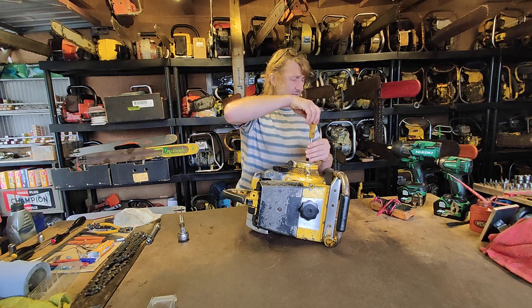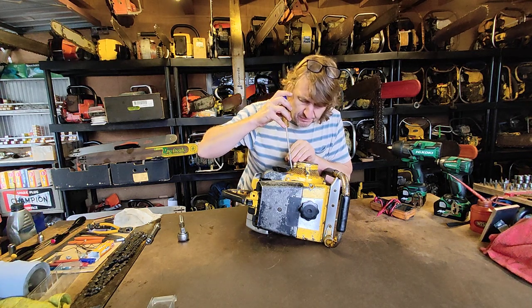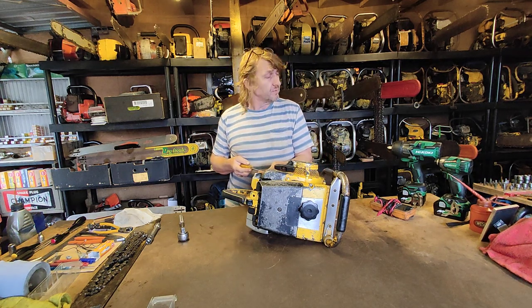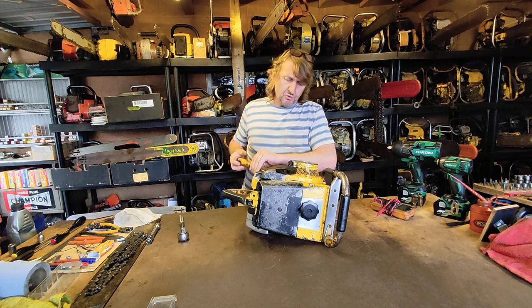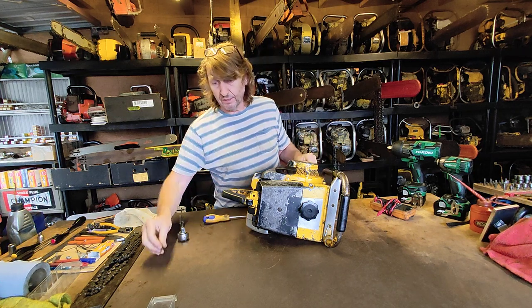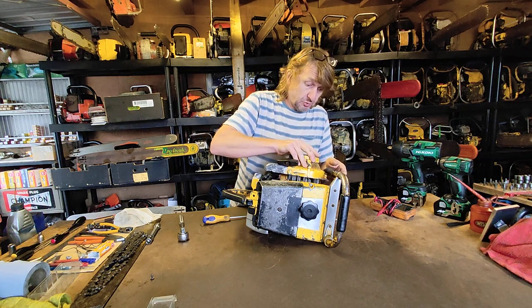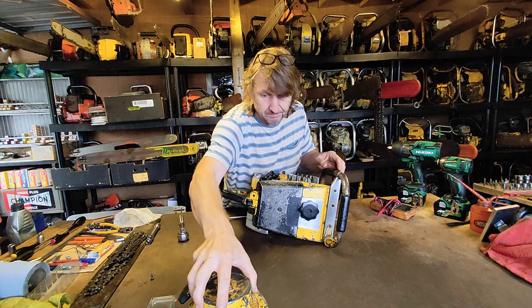While I'm taking this off then, the smaller impact wrenches, because of the size and the momentum they have, if you need to use them for turning something other than undoing a small fastener, they will very, very quickly go into impact mode and start shocking the heads of the nuts and bolts, which is what they're designed for. Okay, off nice and clean.